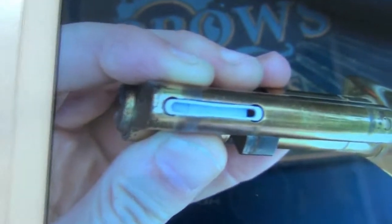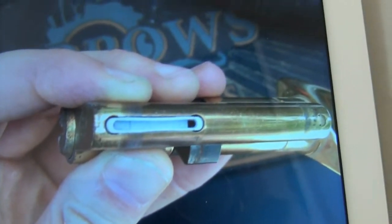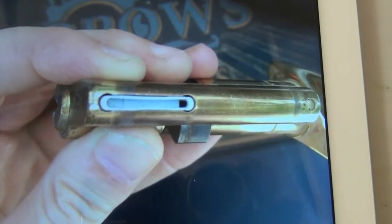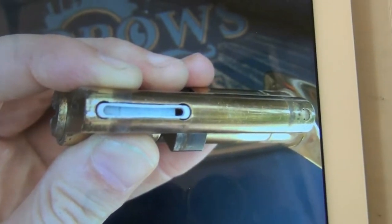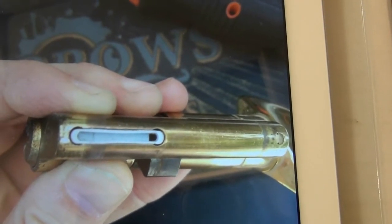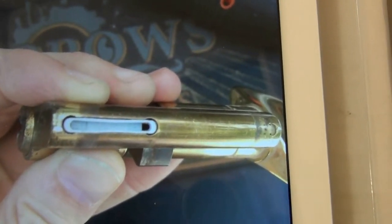Then you go back to fighting with these white caps. I saw tons of videos on how to get these caps off, but nothing really talking about the conversion on the pin chart. That's what it is — you just take whatever the length is supposed to be on a normal size diameter plug and subtract 20 from it.